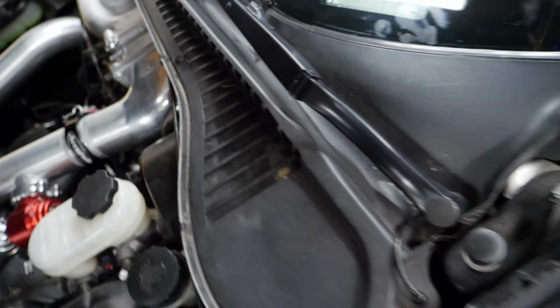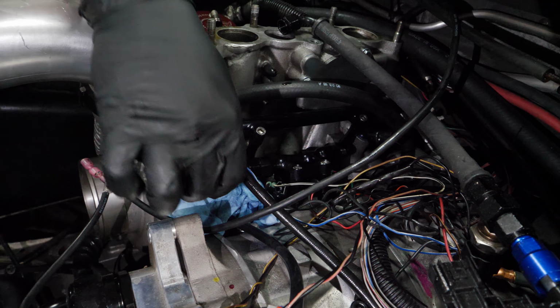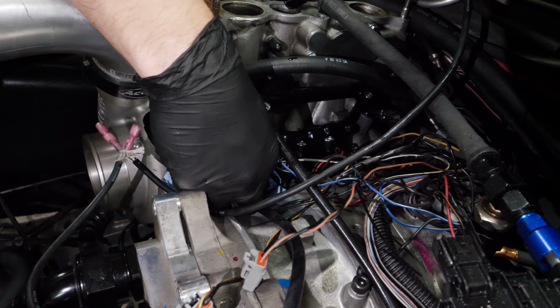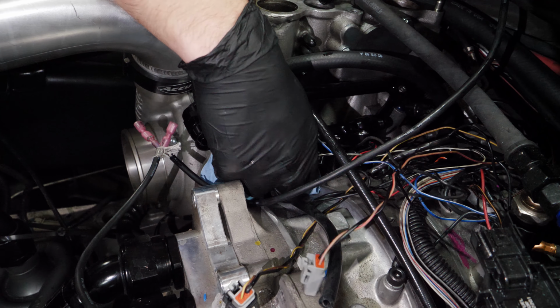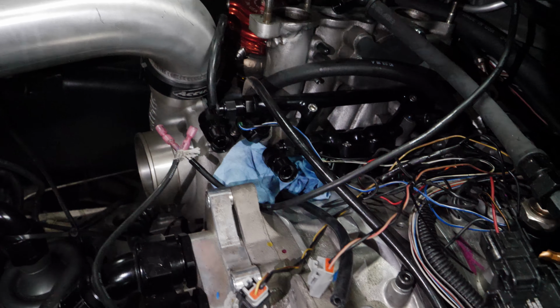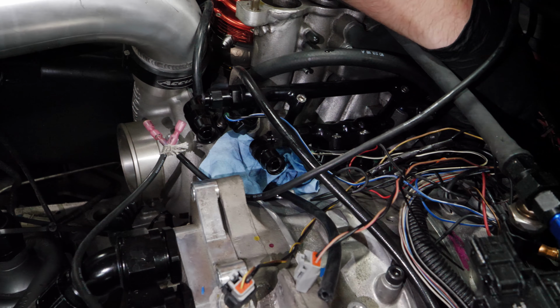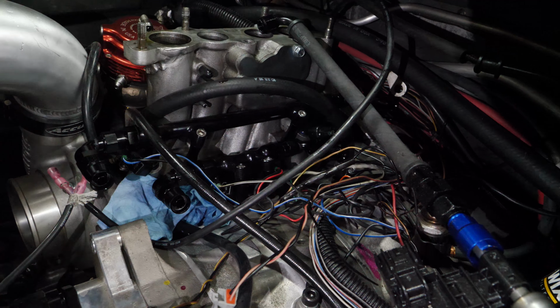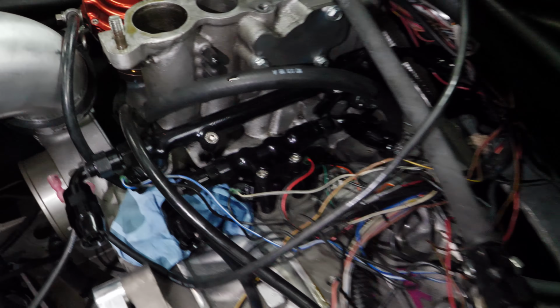All right, so these four pieces are all connecting to the fuel rails. Let's go ahead and set them up and get an idea of size, space, requirement. One of the things Abel introduced me to is the finer quality of things in life, and these fittings are probably the finest, and I will not stop preaching about that. You'll see that these are 90 degree bends, but they curve, and so it does not have as much of an effect on the fuel system as the ones that just crash and do 90 degrees and they're done. These are meant to keep minimal fuel pressure loss along the way. So, what's gonna happen? Where did I set it? Okay.